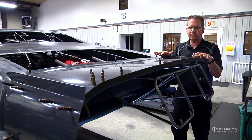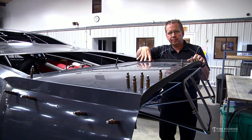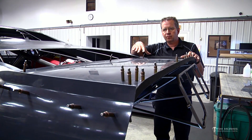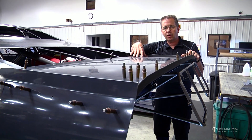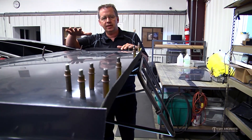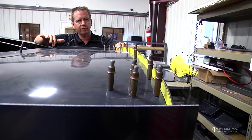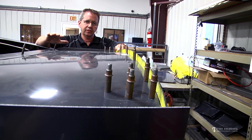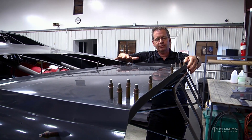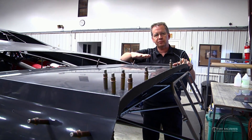The more drag, the more power it's going to take to push it down the racetrack. On an NHRA Pro Mod car, the tracks are prepped very well and they're usually on nice, fairly smooth facilities. We find that we can run an 18-inch deck spoiler on almost every car with no wicker bill — we just don't need that downforce. The track is smooth and they have plenty of bite all the way to the finish line. We can take the wicker bill completely off and they'll handle just fine. The less wicker bill, the looser the car can be on the top end, so it really is your comfort level. You shouldn't just go out there and take your two-inch tall wicker bill off and run zero — you want to take some steps back and see how the car handles.